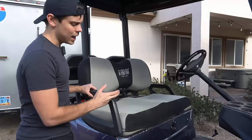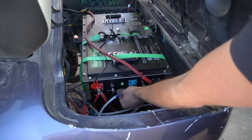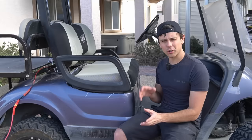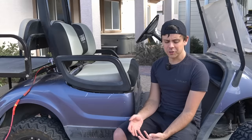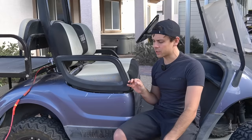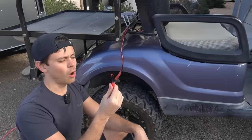I contacted the company and figured out how to connect the braking resistor. I mounted it to the back with self-tapping screws, and they sent a schematic. The braking resistor has two leads — one goes to the terminal labeled brake resistor, and the other goes to the negative terminal of the battery. The cables are waterproof with a nice sheath. I also added the remote external switch because this battery turns itself off to save energy due to the contactor, so you need to turn it back on to drive. The Victron solar charge controller actually wakes the battery up and starts charging even if it's turned off, so charging is not an issue.